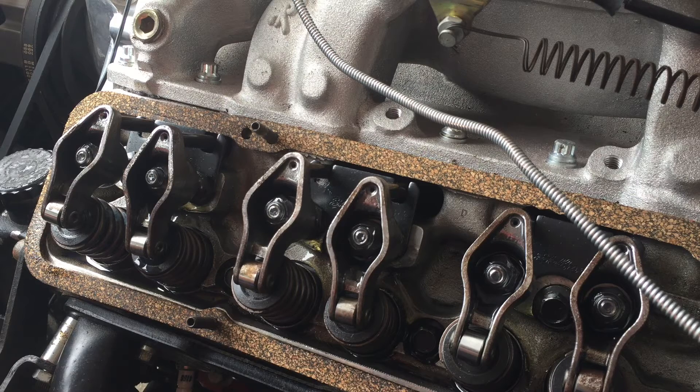I'm going to do the passenger side next. I'll rotate the harmonic balancer completely around and run my drill about ten minutes on each position. Some people may say it's a little overkill, but when you put six or seven grand into an engine, you want to make sure when you start up that everything's getting proper lubrication so your rings can set right. I'll pull out this tool and show you guys what we've got.